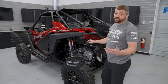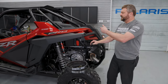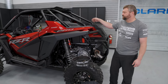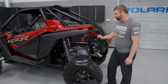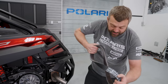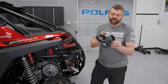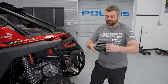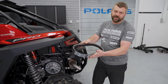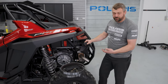As for carrying a spare belt, a lot of guys shove it behind the seat — on the Pro XP there's a nice storage cubby on the passenger floor that holds a belt really well. One thing to avoid: don't twist the belt up like you might see old snowmobilers do — it can cause the belt to crack over time. Try to keep it as round as possible or laid flat in a suitable location.